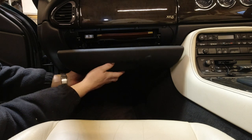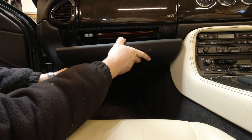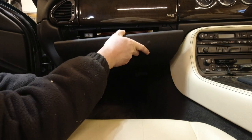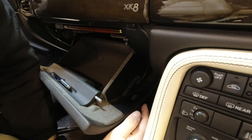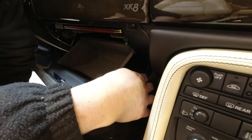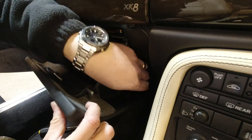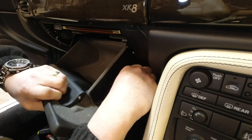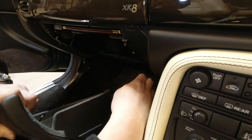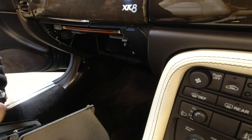Now that the glove box is loose at the bottom, there are a couple of pegs that go into a curved slot. You just need to manoeuvre one of them out of position to unhook the box, and on the side there is a little string that needs unhooking from its clip — essentially a keyhole-shaped slot with a round peg on the back of that clip. Just go and unhook it from that, and that's the glove box door off.